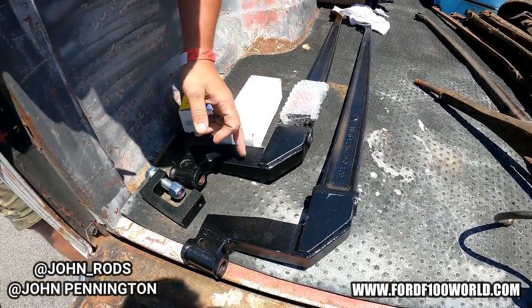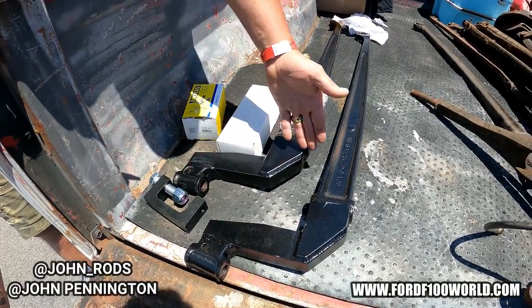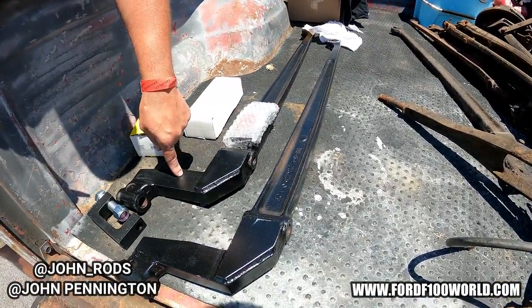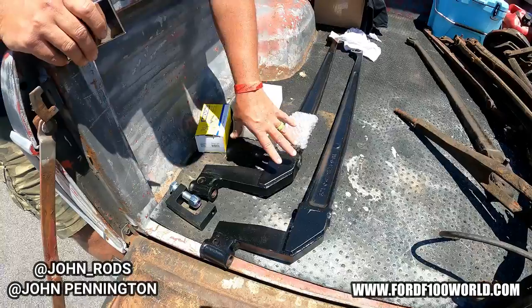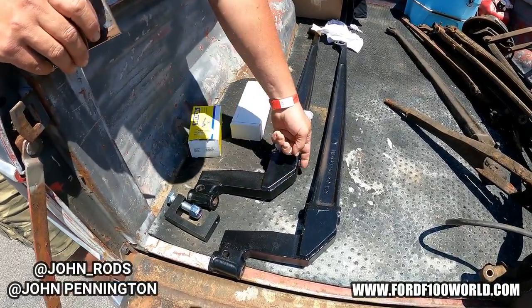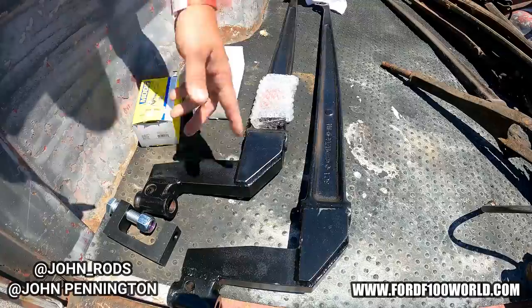I actually cut right here — I have a number that I cut from the center line of the kingpin to here — I cut here and I cut three inches out of it and I cut here. This is a 1018 mild steel, CNC machined with this form on it. I've got a jig set up; I put the beam in it, bolt the beam down. This gets welded all the way around. These are two scab plates that get welded all the way around here, and the eyelet here gets welded all the way around.